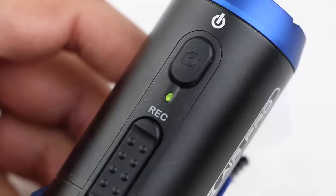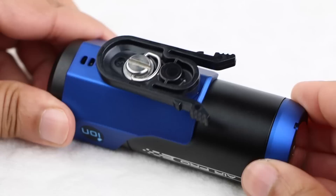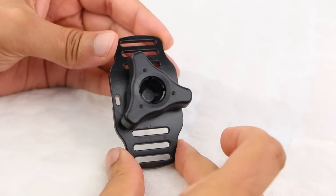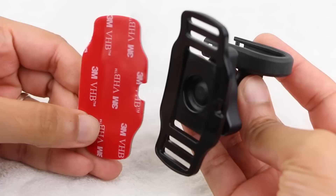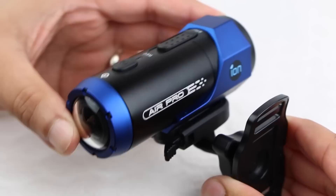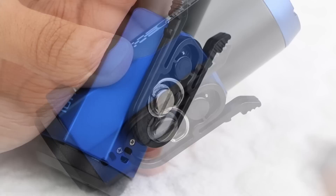The bottom edge is where we find the ION's Cam Lock mounting system, a plastic clip attached to the base of the camera allowing easy attachment and removal from a range of mounting solutions. A variety of options are available, and we have a side helmet mount included in this lite package, including an L-shaped mounting adapter which pops into the helmet mount. A helmet mount can either be attached using the included adhesive pad, or with a strap thanks to the shaped cutouts on the mount itself. The ION Air Pro simply slides and clicks into place, or can be removed from mounts with ease by squeezing the two rear ends of the clip together. The Cam Lock clip itself can be tightened or removed with a flat tip screwdriver, coin or the included keyring to reveal a standard tripod thread.